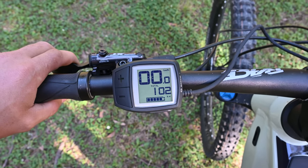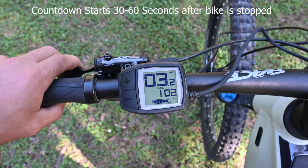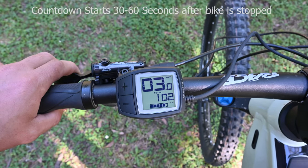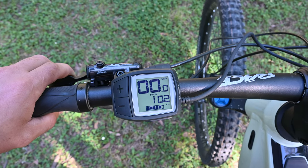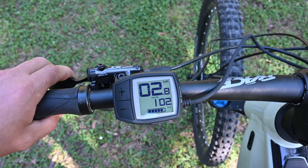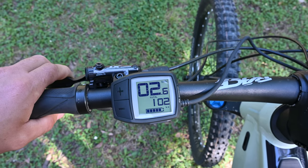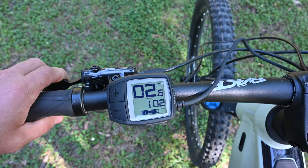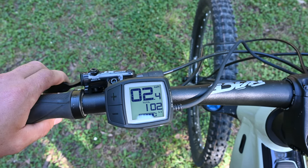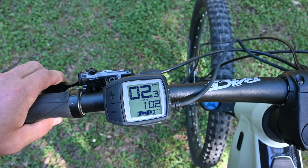When you finish your ride, you'll notice a countdown will come on the screen. This countdown can take up to a minute to start, and what it's doing is defeating the Bosch anti-tampering software to avoid those 504 errors. You can see it counting down now. Once this countdown is complete, it'll say 00 on the display and the bike will be ready to turn off. The best method is to simply leave the bike on at the end of your ride and it will turn off by itself after around 10 minutes sitting idly. You don't have to complete this countdown if you stop at traffic lights and it starts — it's only at the end of the ride that the countdown must be completed.